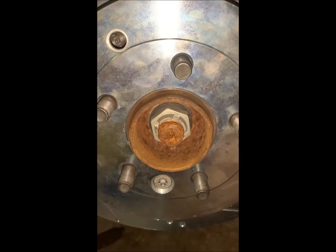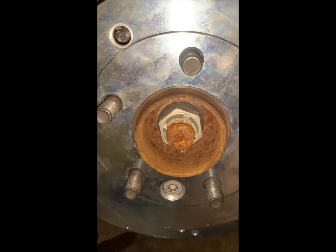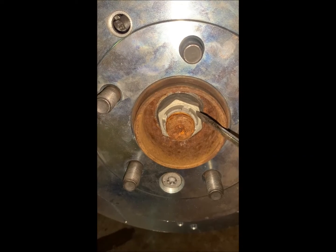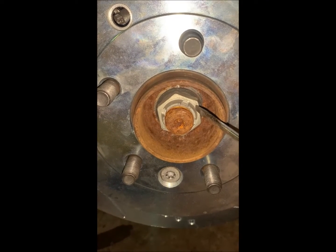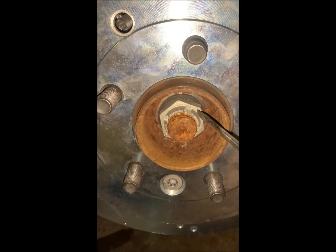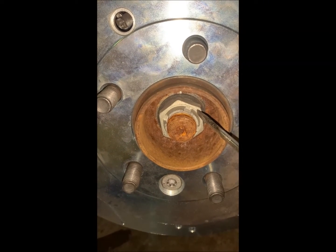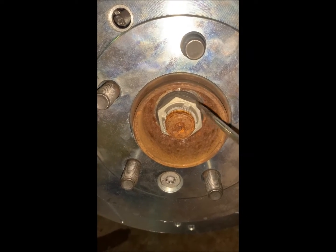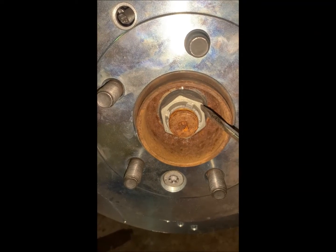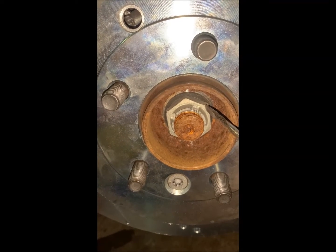Okay, so at this point, let's start adjusting the parking brake. You can see that we've lined up on our adjuster in there so we can get at that. Right now, we need to understand the size on this nut because we will be following the procedure in Bodsy's Bible. Thank you very much for that. It's so amazingly helpful. So most Rovers have this nut and it's 32 millimeters. This truck is 35 millimeters. So again, whatever they had laying around the shop floor that day. So I had to go out and buy a 35mm socket. So understand what's in your truck. Most are 32. This one is apparently 35.